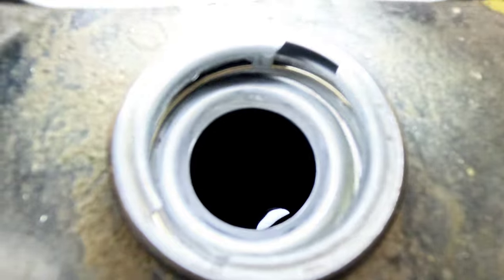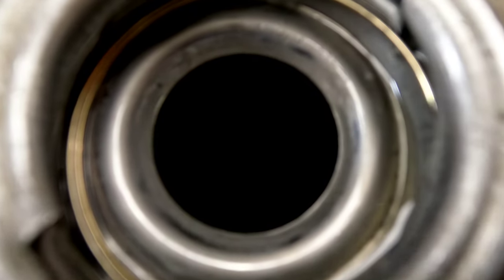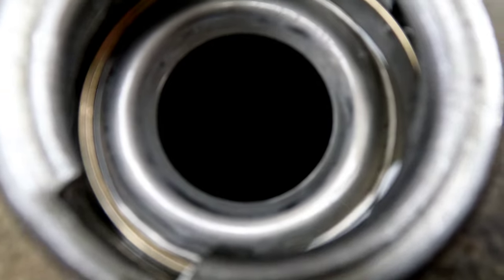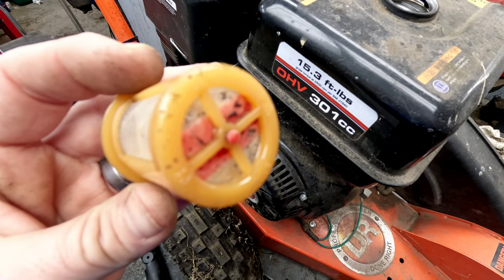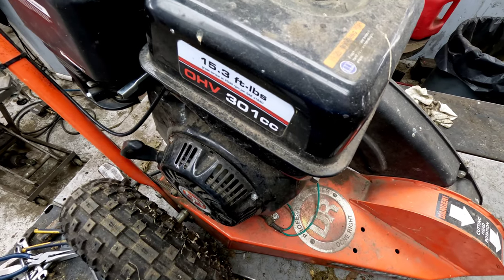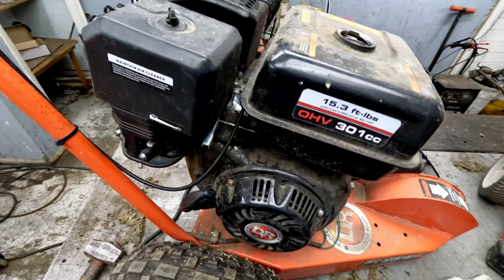If we look down in there, what do we see? Basically black. Very, very cloudy. You can't see to the bottom or anything like that. And the gas is black. I'm not sure exactly what's going on, but you can see some black flecks at the bottom of the screen here also. So looks like he's got some issues maybe with the fuel tank or can he's using, getting some pieces of some rubber in it that are making it down through,